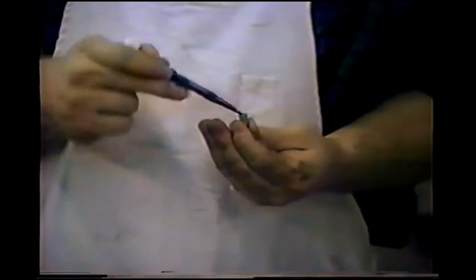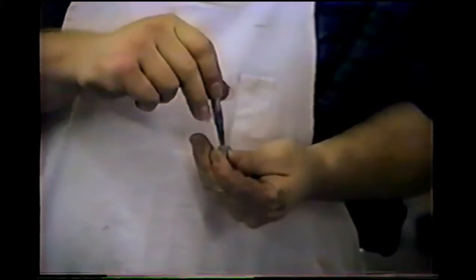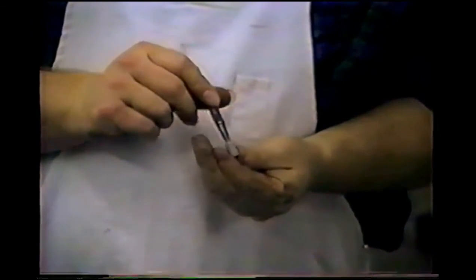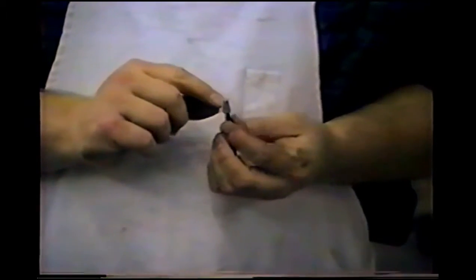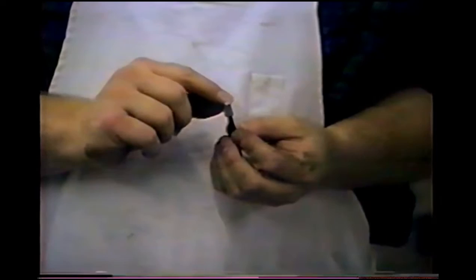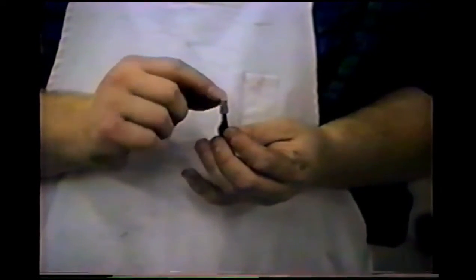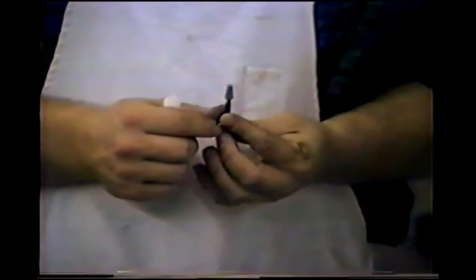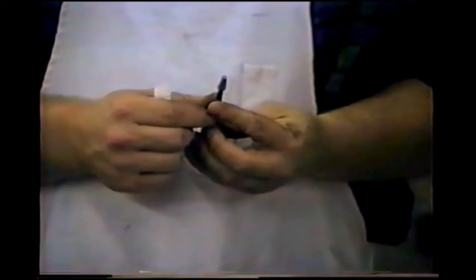And then screw the nail set right on top of the wire nut. And as soon as the super glue dries, I'll just trim these little ribs off that are on the wire nut, flatten the top of that out a little bit, and then we'll put some tape over it and be ready to tap down dents.